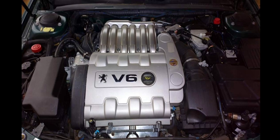That's what I mean. The ECUs, once the ignition is on, they are constantly powering and receiving signals from some of these electrical control components attached on the engines. So spraying water in there and expecting those computers to work very well is a very, very big risk that you could lose the entire vehicle, not just burn your ECUs. You will lose that vehicle if it catches fire or something. So anyway, that's aside. Now, how do I wash my engines?